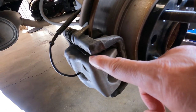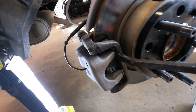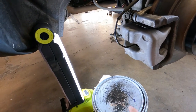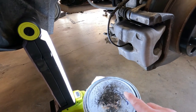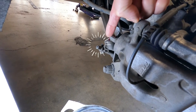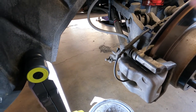The way that you want to do it is you're going to need to wedge a little tool like a pry bar — one here and one down here — and this caliper will come off. I also recommend that you get a little one-gallon bucket to set your caliper onto so that it doesn't go anywhere. You will see that you have your emergency brake line right here — you do not have to disconnect it. From here I'm going to remove all this and set it down so you guys can see.